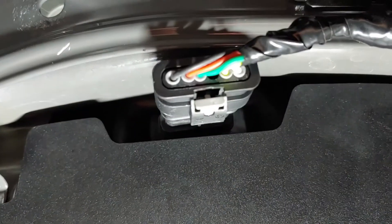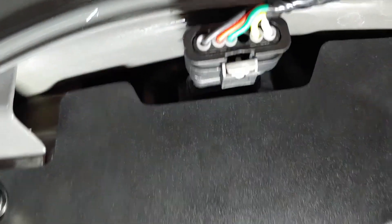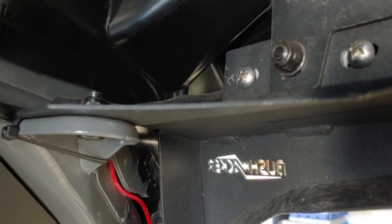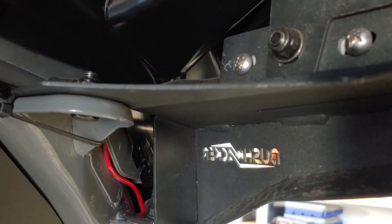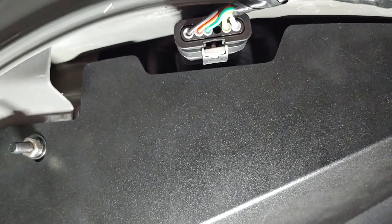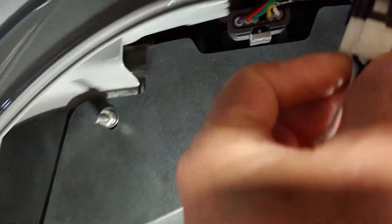Up in here is where your main harness comes out for the LEDs. You can see there's a green wire, a yellow wire, a white wire, a red-yellow wire, and a black wire — five total. The installed LED uses three of them: red is for the daytime running light, yellow is for the turn signal amber, and black is for ground. The red feeds directly into the green and yellow, which are twisted together, while the white sits on its own. The relay sits up in here on the new harness.